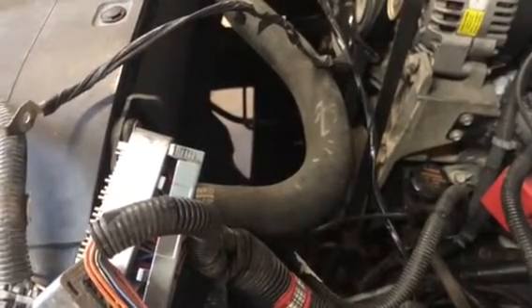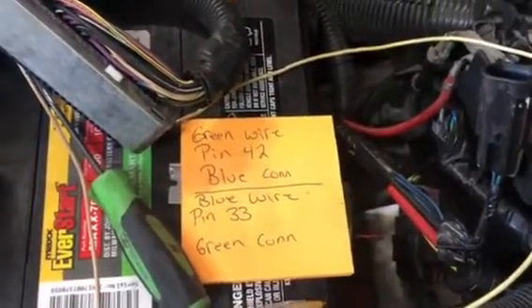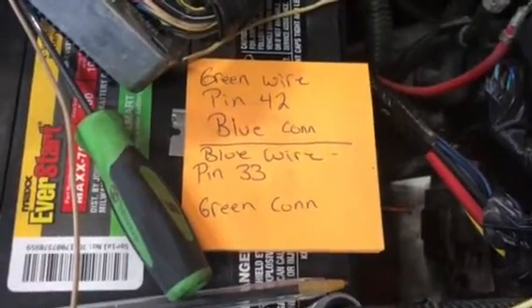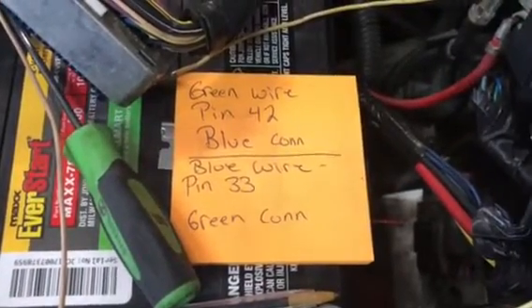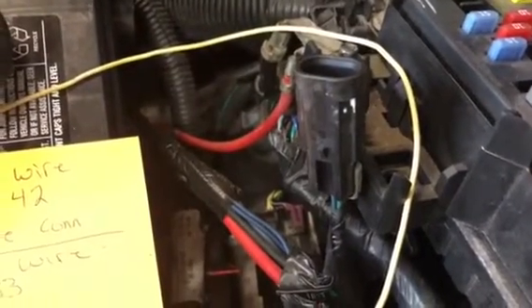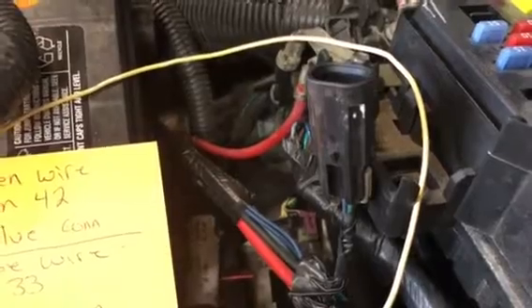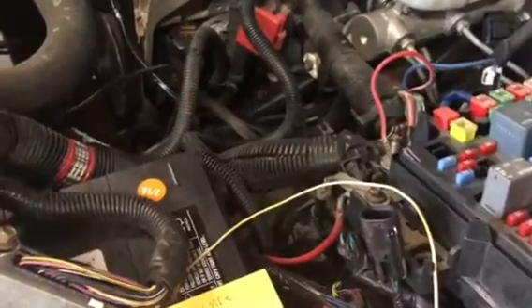But it's fairly simplistic. I know this is a quick overview — I've had many people ask me about this, and there's some good information on the internet but the picture for the wiring diagram is kind of hard to follow. So if you get yourself a factory harness, you're going to need two little pigtails to go into the PCM. If you don't grab the corresponding side off the donor truck, you're going to go one to pin 42, one to pin 33, then run it down to your connector right here. I'd get a weather pack connector — make it nice and clean and make it look like you care about what you're doing. Once I get all done with this, it's going to look pretty close to the factory way it's done, minus the incorrect wire color and the extra looming we're going to do on the bottom for the harness. In my opinion, you'd like to make it look as close to factory as possible — nice and clean and functioning correctly.